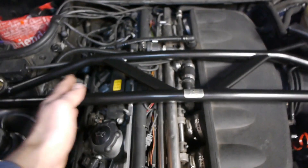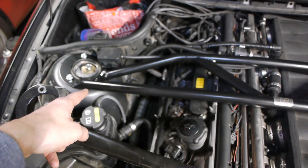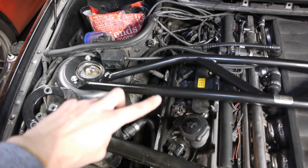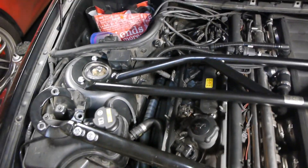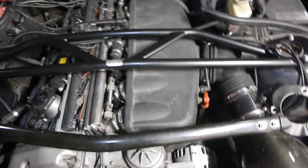One cool thing I checked is that if you want to do a spark plug change or compression test, the Rogue bar's spacing means you don't have to remove it entirely. With the stock bar, you can remove the four 13mm bolts and remove the centerpiece without touching the shock tower ends, opening up the middle. With the Rogue Engineering bar — and I think similarly the Mason one, as I believe Rogue sources it from Mason or Mason from Rogue, it's actually the same bar if you're buying the steel version — the whole thing has to come apart together.